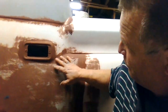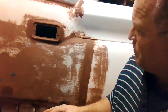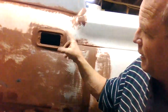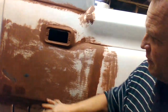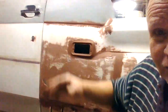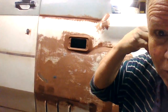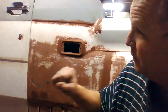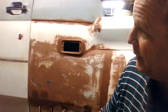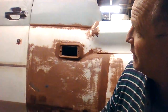I finally got all of this taken care of now. I just put primer on where it was bare metal because I don't want it to rust while I'm working. Eventually I'm planning on taking all the lights and stuff out, taping off the windows, cleaning it, and then going at it with the sander — probably a 180, then finishing up and going to a 320 to get it smoothed out.